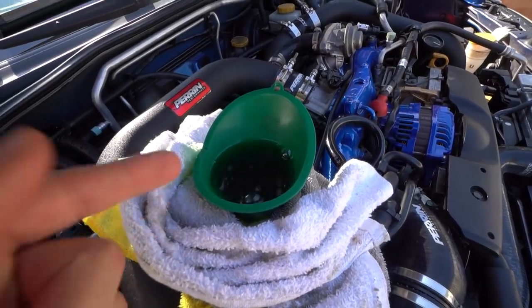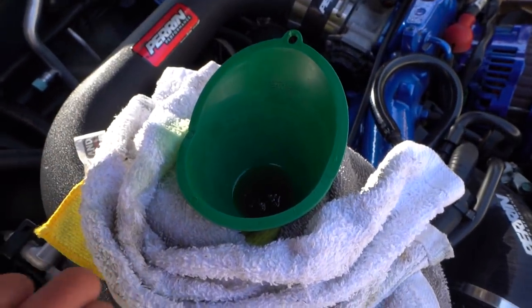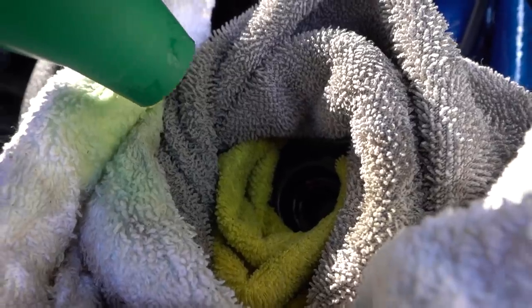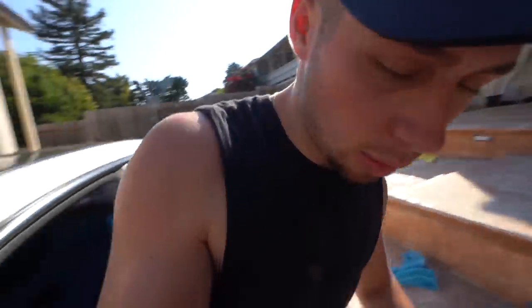The thermostat just opened again — you can see the level coming down with a lot of bubbles coming up. This is now the third time the thermostat has opened; the level rises then goes down. It's at a really good level now. I'll top it off just a little bit more and let it cycle again. It's all good — all bled out. I let the thermostat open about four or five times. To be honest, I'm not seeing any cooler temps on the gauge right now, but as long as the temperature in cylinder 4 is cooled down and we're getting better circulation, that's all I really care about. We're going to go ahead and drive it, and maybe give an update in a few days to see if temps do get lower.